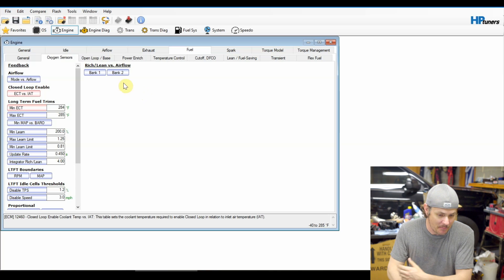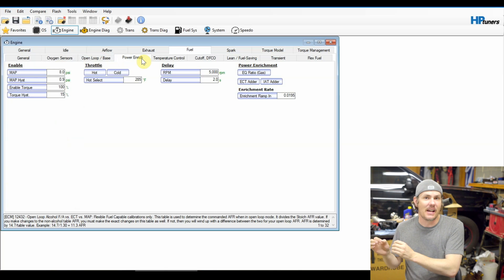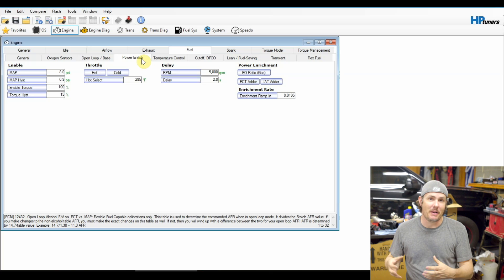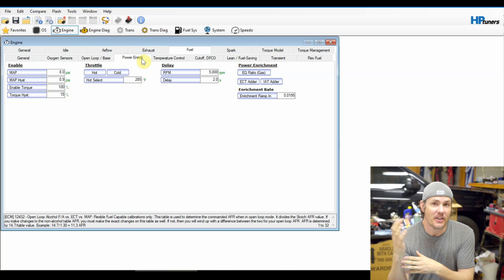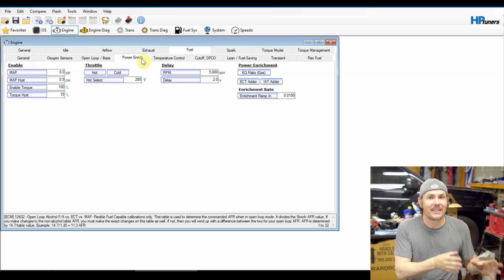Let's look at some of the other tabs. Under Open Loop, we're not worried about that. Power enrichment — we're going to leave power enrichment enabled because this affects your commanded AFR or commanded EQ ratio table. Whenever it commands a different AFR, we should see that on our wideband and it should match up. The reason people tell you to disable power enrichment is because they're telling you how to do it through long-term fuel trim tuning, which is not an effective way of tuning. You really need to have a wideband on there because narrow bands cannot operate underneath power enrichment — narrow bands are required to switch between zero and one whenever they are around stoich, but when you're in power enrichment you're very rich, so your narrow bands will just read one state. Because of that, you'd have to disable power enrichment, which makes it very dangerous since cylinder temperatures get very high during wide open throttle pulls. Since we're using a wideband on this setup, we can leave power enrichment enabled.